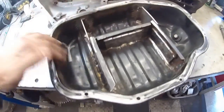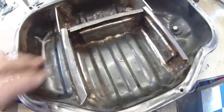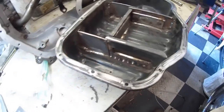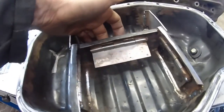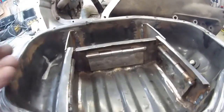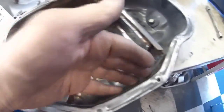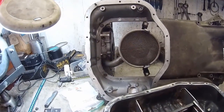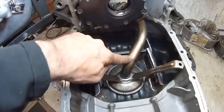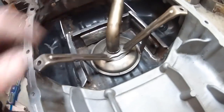Here's a close-up. We've got two wells on the outside, so any oil that ends up in these wells goes through into the center via a trapdoor going that way, a trapdoor going this way, and any oil that ends up down the front goes through this trapdoor — it all ends up in this central area, which is where we want it. It's fabricated from 1.2mm steel plate. You can see the hinges here — I linished the hinge pins down slightly to make sure they're free, and put a tack weld on the end of them to hold them in. They're all super free, which is what you want. The reason we haven't done one at the back is that the oil pickup is already offset rearward on this sump, so we only needed to put baffles on these three sides.